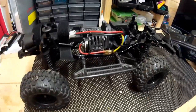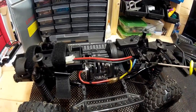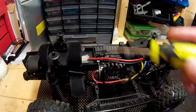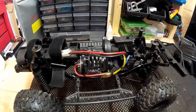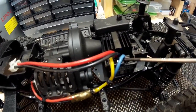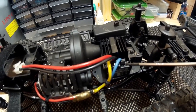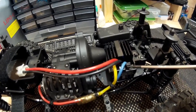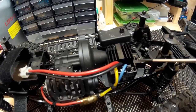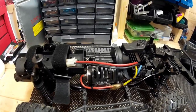I'm also going to start running this on a 2S LiPo. In my previous videos it's just been running on a standard 6-cell NiMH battery. On the ESC it's just got this standard little plug that you move along — if you want NiMH batteries you put it in one position, for LiPo batteries you put it in another position. So I've changed that and I'm going to now run this on LiPo.